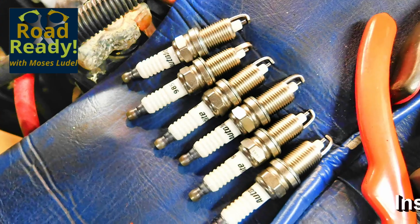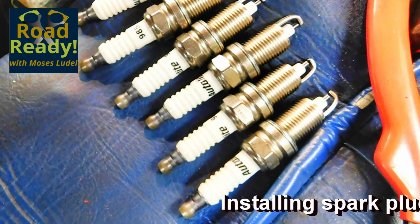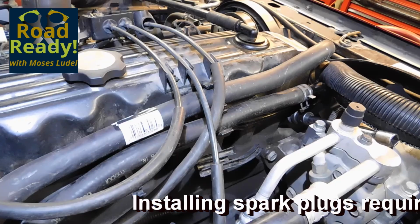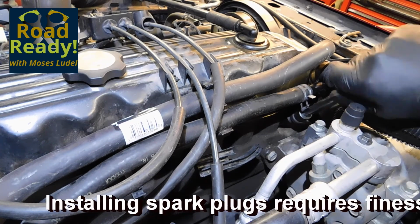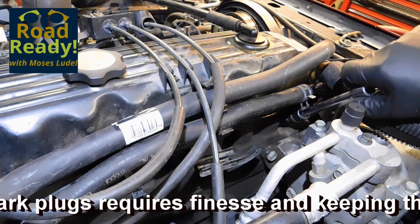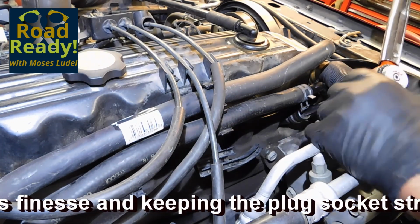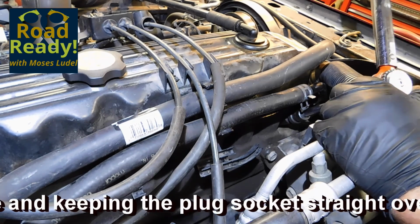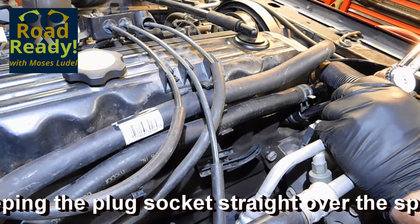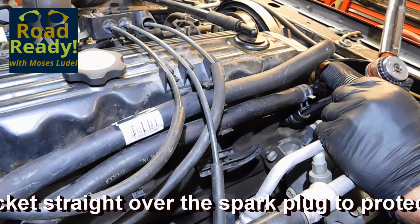These spark plugs are now gapped to 35 thousandths, and they will also be the right heat range. Always start the spark plugs by hand and carefully. The rubber insert in the Snap-on swivel socket holds the plug in place. The plug is completely seated by hand before the torque wrench is applied. This is a 3/8 torque wrench, and I'm setting the torque to the factory specification.